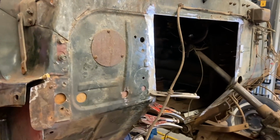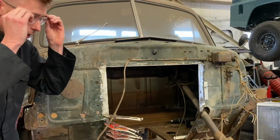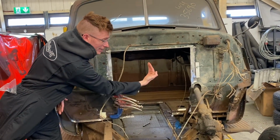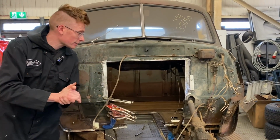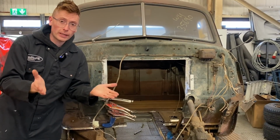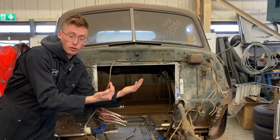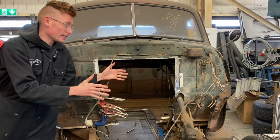And that's because the 606 engine, even though this did have a 6-cylinder engine in it, the original 6-cylinder, has a nice little notch in the bulkhead, and the engine just sits into it. Well, the 606 sits over at 15 degrees. For all intents and purposes, it might as well be a V12, because the engine sits like that and the manifold and everything else sits the other way. So for a straight 6 engine, it's really broad. And obviously that needed to go into the firewall.